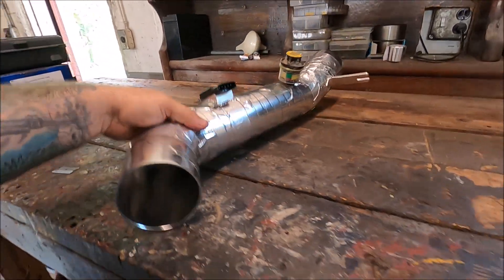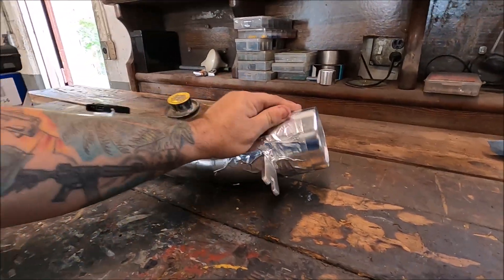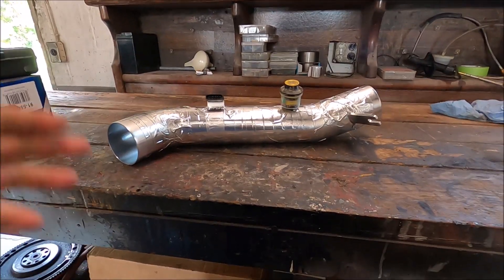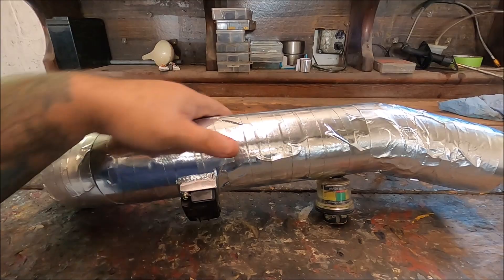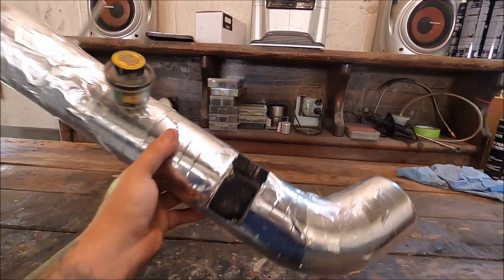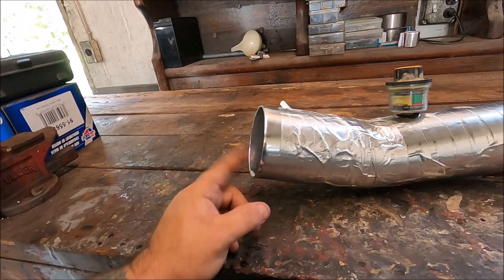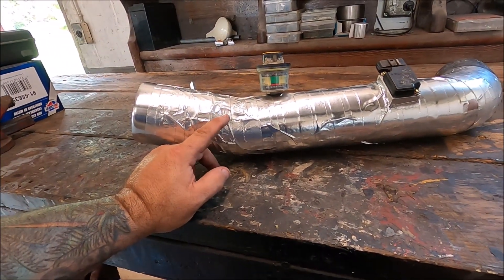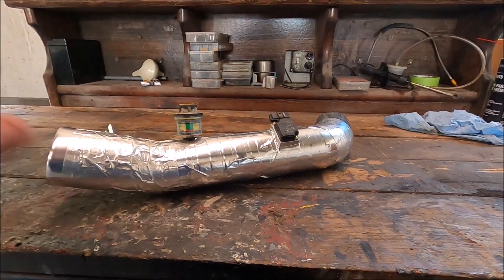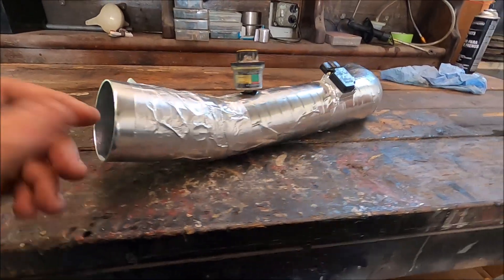Well, she is fully wrapped. Every inch I could cover is covered on this thing. It doesn't look like the greatest thing in the world, but if you compare it to NASA probes out in space that have that gold or silver tape on them, this is kind of the same thing, I guess. What we're going to do is put this on the truck, leave the filter on, start the truck up, let it run for about 10 minutes with the hood closed, shut it off, and then measure the outside and inside of the tubing to see if it made a difference. Let's get this thing back on.